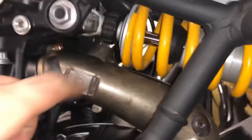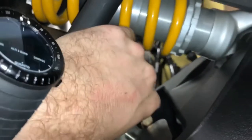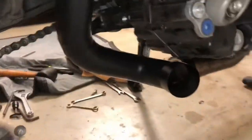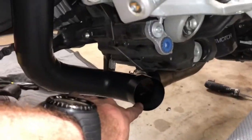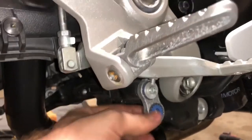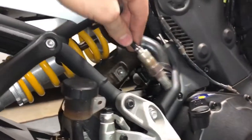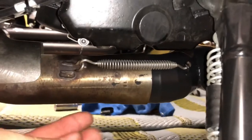The clamp is back on but not completely tightened. This piece went back on with the original screws for the first two and then a replacement one back there for the others — it's still a little loose so I have a little play. I'll tap that up until that hole lines up. Next we're going to install the down pipe all the way back on — that'll connect to the other part on the other side — then put the O2 sensor back and button everything up. There's also a servo that was connected there which won't be there anymore — there's a little hack to fix that.